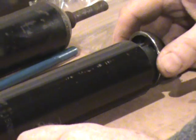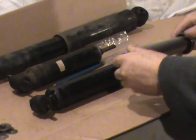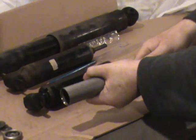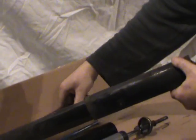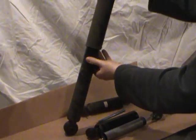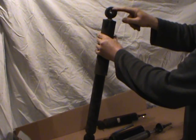So that's basically it. The valve isn't in there because everything would just start flying around, and it's only going to the junkyard anyway. I may salvage some of the steel here for future projects. That's how you have it for the front shock. Here's a comparison in size to a rear shock — like almost twice the size. Same thing with the rear shock: this particular one mounts with this end on the axle and the other end on a bracket just underneath the frame of the vehicle.